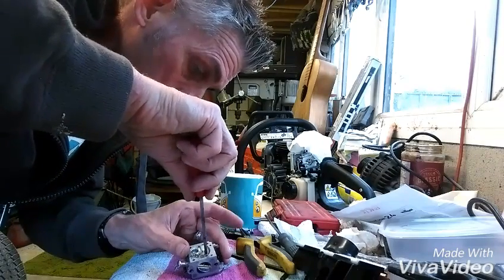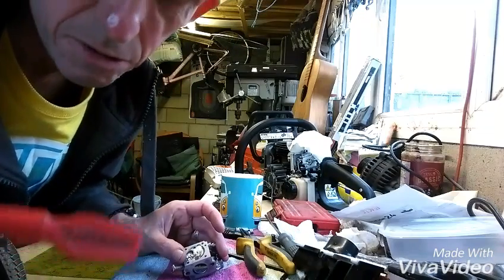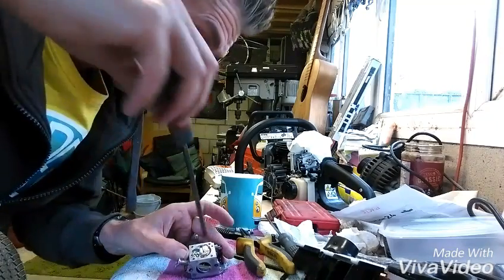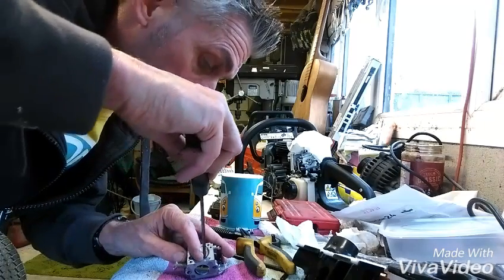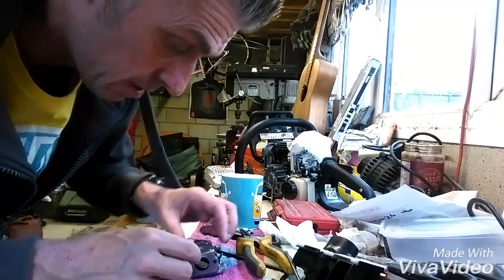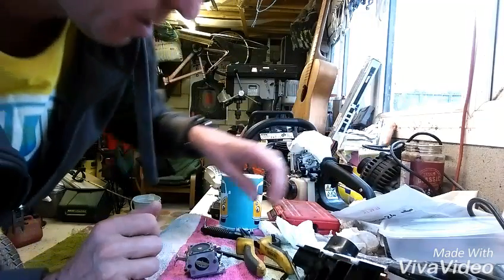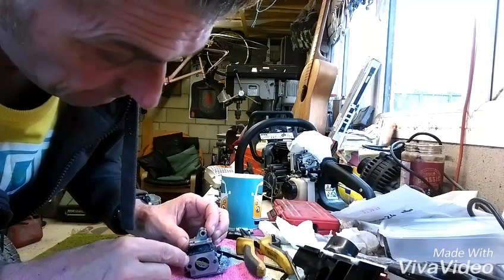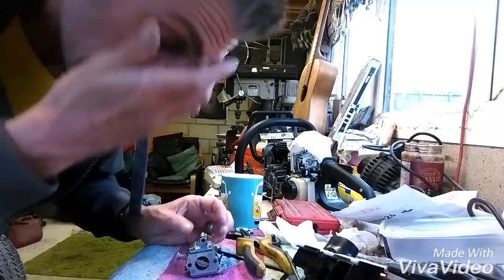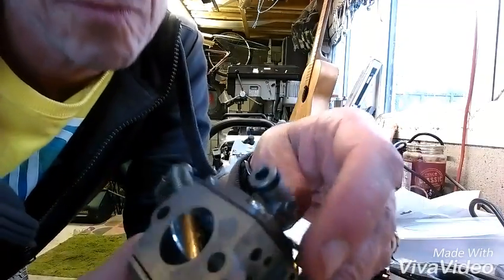You've got to make sure you've got a decent screwdriver. Mine's a very old screwdriver, mine's a little bit worn. Right, see if I'm back on there now. And now we'll stick the carb body back on again with that facing the choke. So four different bolts - screws - they go in there. Carb all back together again now.